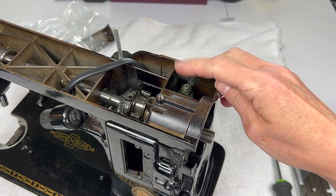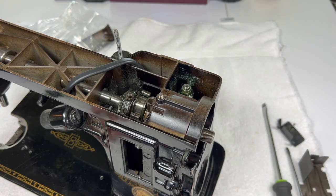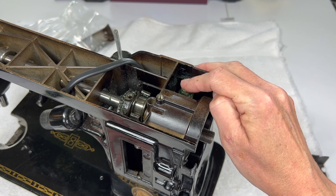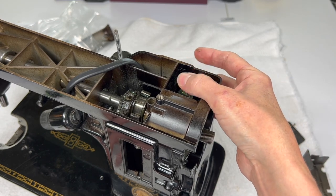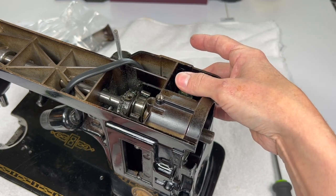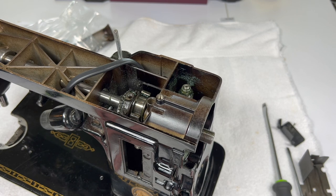Here is the very top of the motor — it's pretty long and skinny. It comes all the way up here and goes all the way down to the bottom of the machine. The way I will get it out is I'm going to cover the end of this worm gear and I am going to give it a couple of light taps. Generally that's all it takes. I will not hit my hammer right on top — I'll provide some cushion between my hammer and the metal of the motor, and hopefully that prevents me from damaging anything. People may have different opinions on whether or not you should do this, but this is how it works for me and my hands aren't strong enough to work it free any other way.